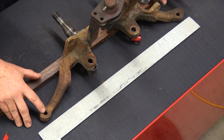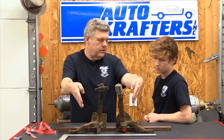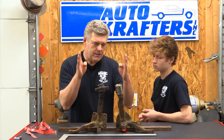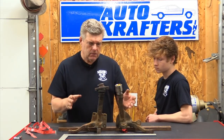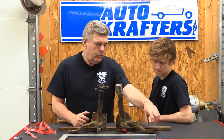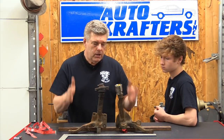If you try to run these on a car, your tie rods will not allow for enough toe adjustment. Toe is — when you're looking at the car from overhead — you want to put about a sixteenth of an inch of toe into the car when you're driving it, so the tires point toward a center point. If you run them straight out, a car will want to wander and hunt with radial tires. The problem is, if you put the correct short outer tie rod in with the 65 Falcon and 65-66 Mustang drag link, you can't get enough adjustment to get the toe where you should have it.